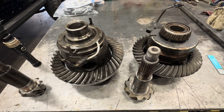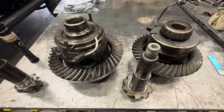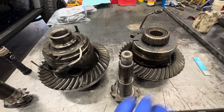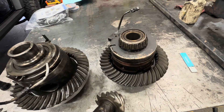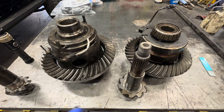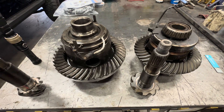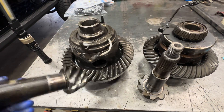Your driving style will predict that. If you drive it mellow and save it, you'll probably be fine. Going with an eight-speed, you don't need to go with really low gears. With 35s you could probably do a 4.56 gear. If you're going 37s, we never go lower than 4.88 — that's it, because there's a pinion problem.